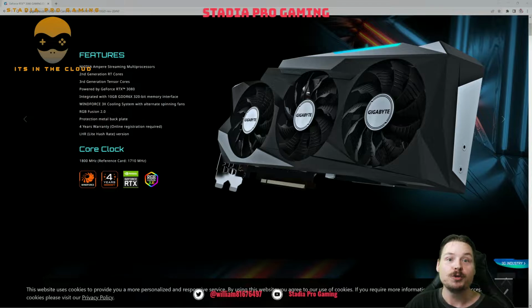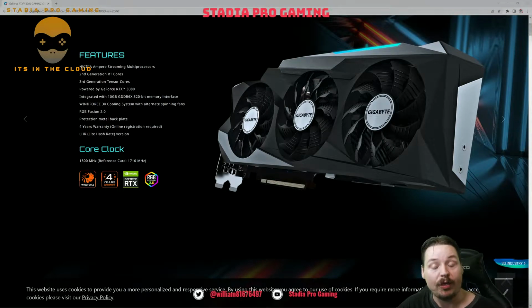Now, when the motherboard first boots up, it goes from a red to yellow light to a green light to nothing. Now, I don't have the little speaker plugged in so that it beeps at you to let you know that it posted. We could have put one on, I guess, but we didn't. And anyway, we thought that it had booted, but we weren't getting any video from the card.